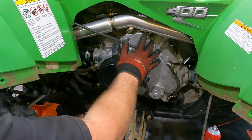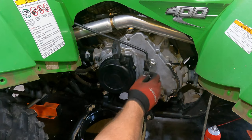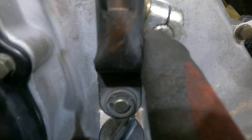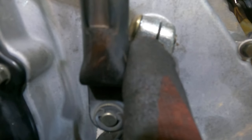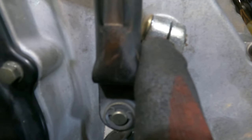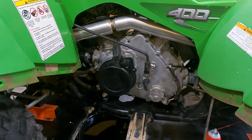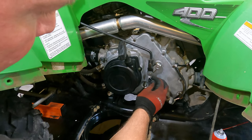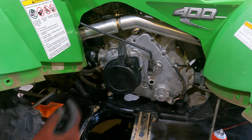Got everything back installed - 11 Newton meters, 10.8 or 8 foot-pounds on those. On units that don't have a mark, a lot of them will have this little dimple here to line up the shift knuckle. If I don't have that, I'll use my center punch and mark it so I know where it was when I got the unit. This unit takes 2,900 milliliters of oil. The worst part is honestly where the fill is at. I'll go ahead and add oil, then we'll turn it over and see if the thing fires off.